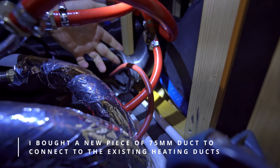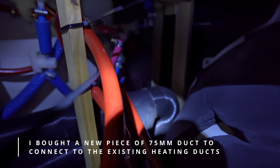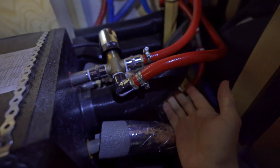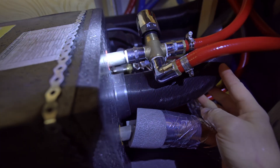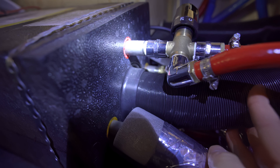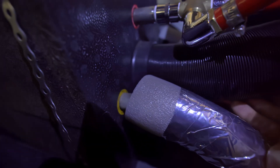We finally got the last piece of the puzzle to finish off our hot water system — the air duct to go from the diesel heater to our hot water. Installing that and the hot water system is done and completed! The diesel hot air is connected to a Y piece. We reconnected it and brought it through to here. The new diesel hot air pipe goes straight in from the Y piece down into the inlet — normally it's 90mm that goes around the outside of the inlet, but you put it on the inside and it sits there really well.